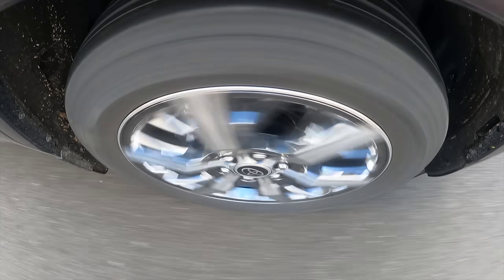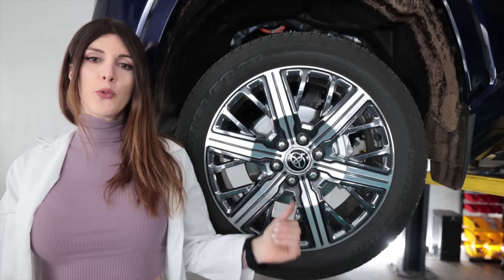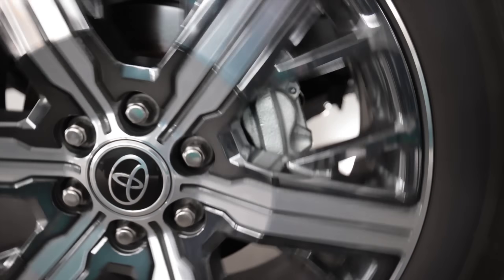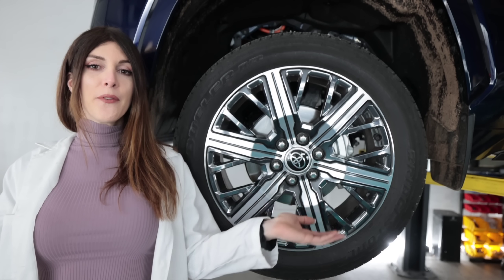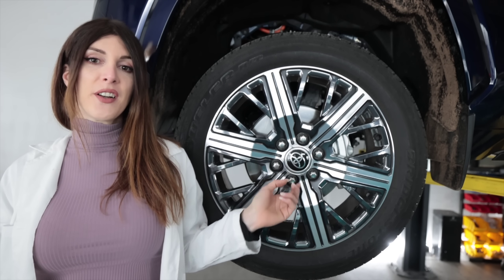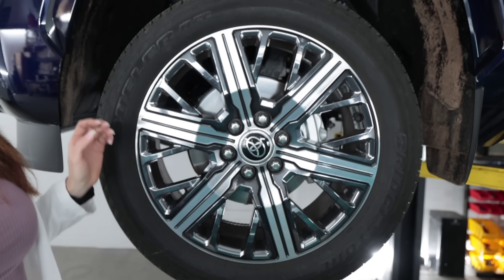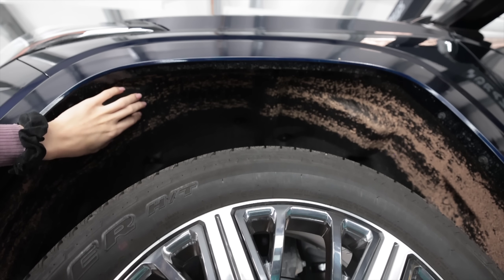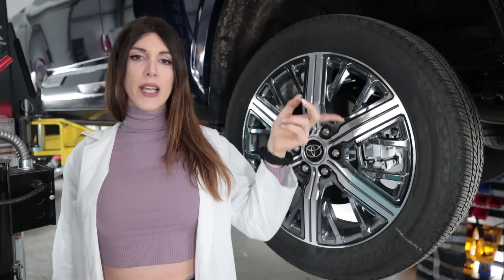Time for the braking test. Wow, that's really good, especially considering it's a little damp. That braking was accomplished thanks to a modest set of 353-millimeter (13.9-inch) front rotors with a four-piston dual-opposed caliper. The wheels are 22-inch, half plastic and half alloy. I feel Toyota missed an opportunity for forged BBS or Rays wheels. They're wrapped in 265/50 Bridgestone Dueler tires — not really off-road tires, but they'll get the job done. Out back there's a 345-millimeter (13.6-inch) rotor with a single-piston caliper; wheel and tire size is the same as up front.